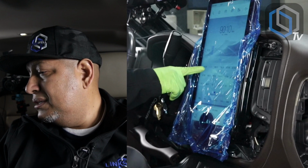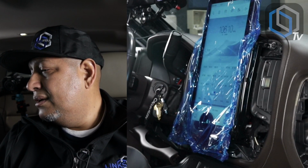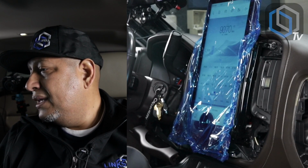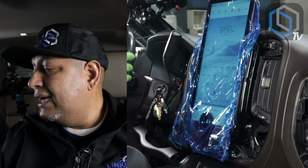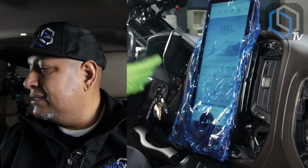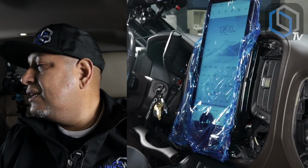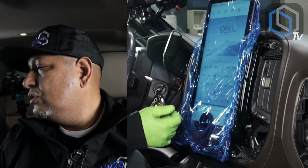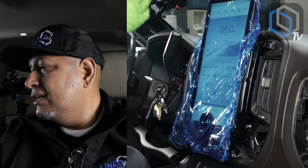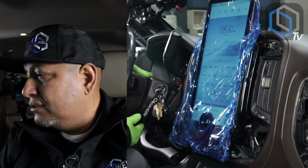It went to the next preset, next preset, and then I'm going to go down, previous preset, previous preset. So that's working now. This particular vehicle has a secondary function on the steering wheel controls. If you press it once, it goes preset up. If you press and hold it, it does seek up, so it's seeking through the different radio stations. Press and hold it down, it'll do a seek down function. So our connection with the T-harness underneath the steering wheel column is great.